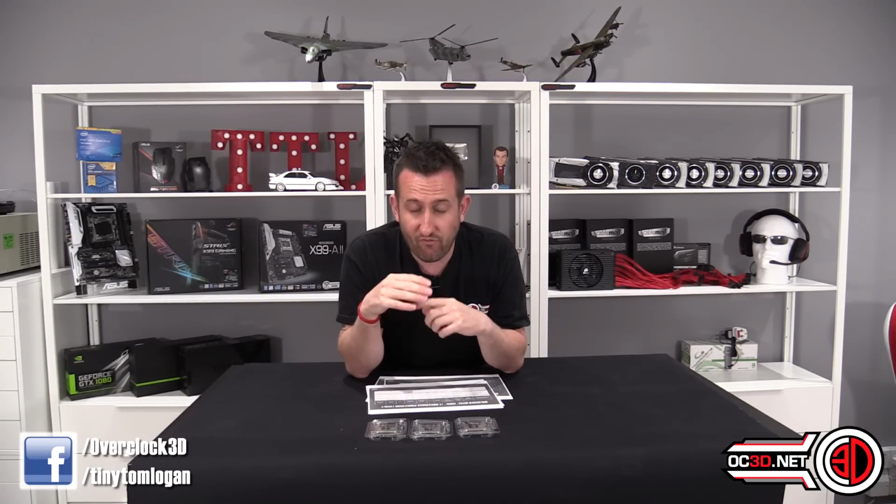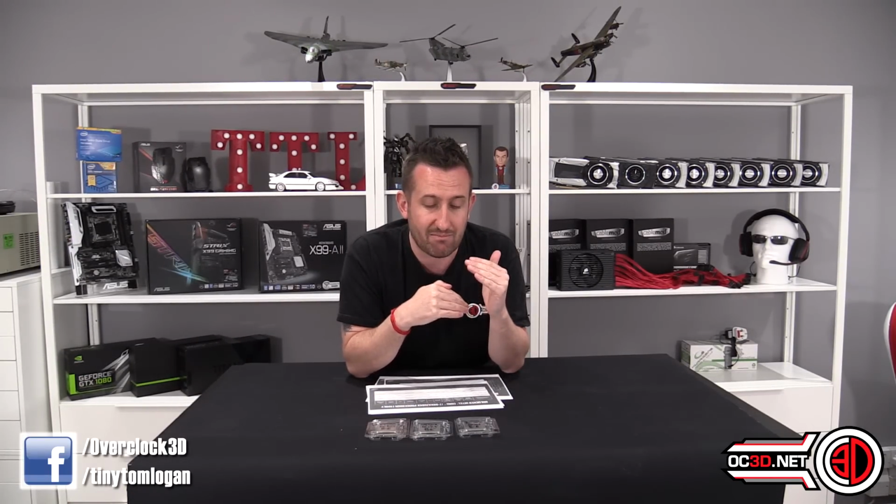But with the 40 lane ones, what you get is both the 2 cards, if you're going to run 2, they both get 16 lanes each, and they gobble up 32 of those PCI Express lanes in total, and then the leftovers are there for your things like your U.2 and your other PCI Express 3 bandwidth hungry things. And at the moment it's really about drives.